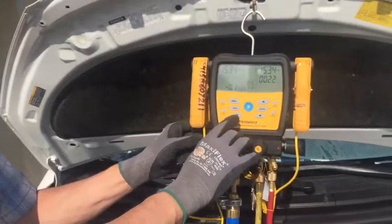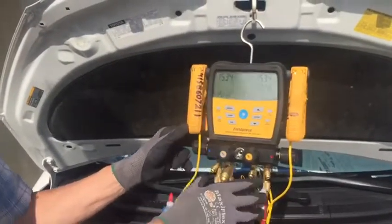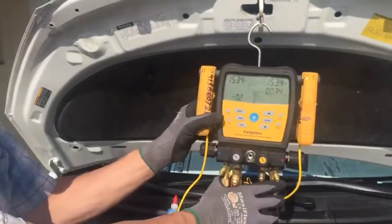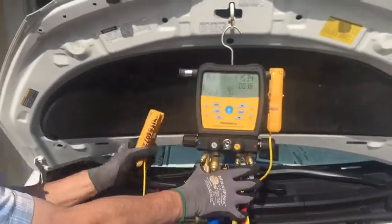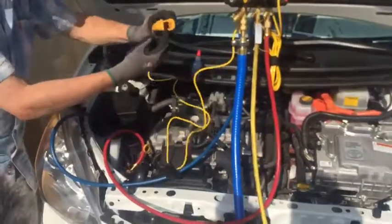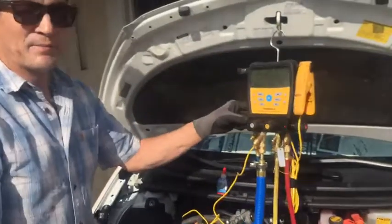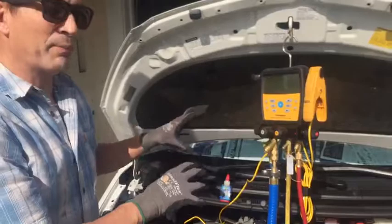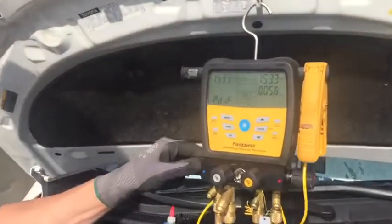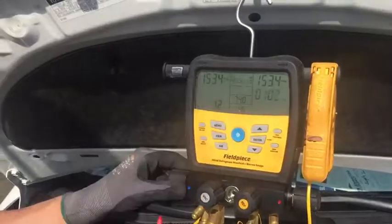What you can read on digital gauges, you cannot read on old analog mechanical gauges for small pressure changes. And if you want to do an overnight test because you spent eight hours on a dash for an evaporator, use temperature compensation. Take the low-side meter — it has a thermistor. Clamp it onto one of your pipes and it will literally take the temperature of the pipe to give you the temperature of the gas. It will compensate for expansion and contraction when night temperatures go down and day temperatures go up, so you don't get false readings.